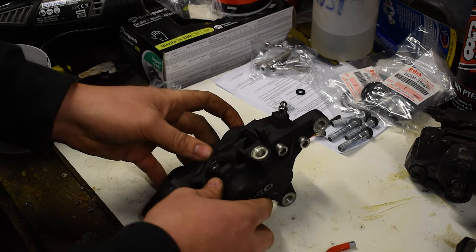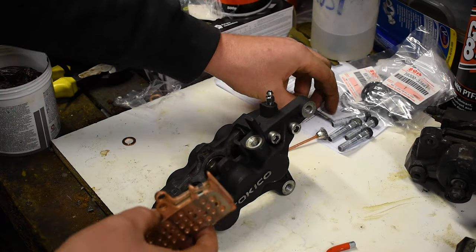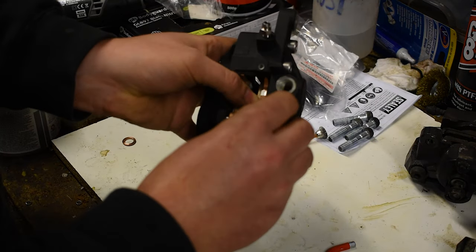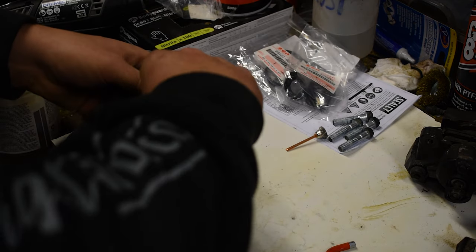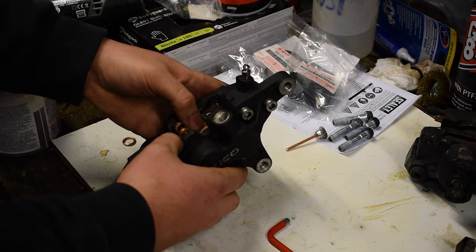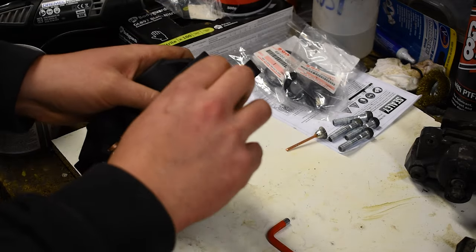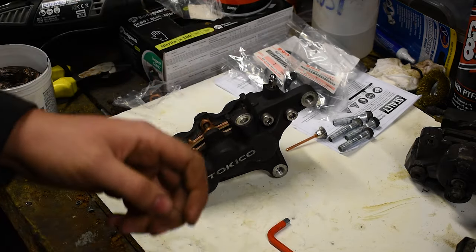And then what we want to do is put back in our new brake pads. I forgot the word brake pads. And of course, do not forget your cotter pin onto your brake pad holder. That is one rebuilt caliper, and that can pretty much go back onto the bike now, which is fantastic. So I do need to get a little cover for the stainless steel bleed nipple, and that's it. I am very happy that's done.